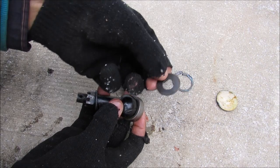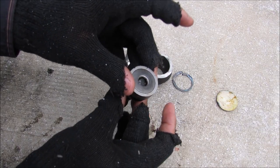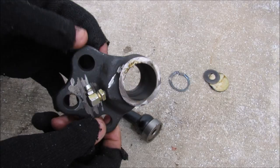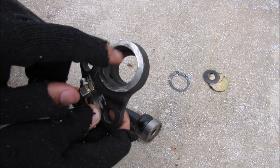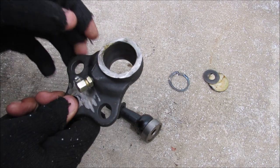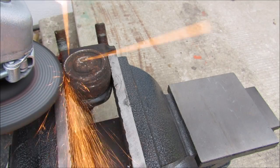And then we've got the spring washer, which sits on the lower sintered bearing. And what that does, it provides some pre-tension when this backing plate goes on top of it and it's laminated on. Finally, we've got the forged housing here. It's got this grease fitting on it with a hole on the inside, so we can grease the internal components of the ball joint and then flush out the contaminants through the boot. Let's open up the OEM-style ball joint to see what it looks like inside.